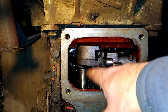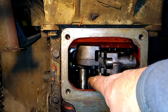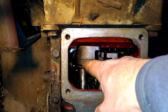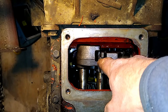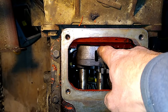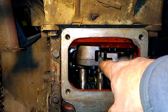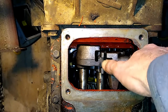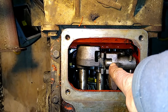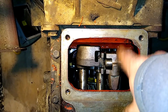So when you slide this lever back and forth, that is currently in 5th gear. When you move it down there, that is 4th. And when it comes back to the central position, this will then move it between 2nd and 3rd — I think that's right. And then when you pull the lever over onto this spring-loaded pin, this is like the lockout for reverse and 1st, or super low, and that will move that gate back and forth.